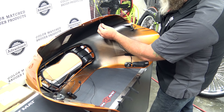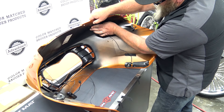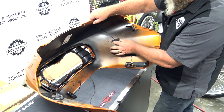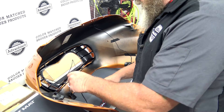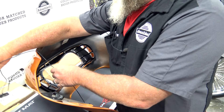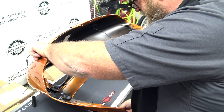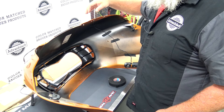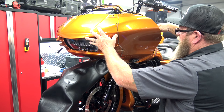When you're taping your wire back up in here, you want your wire to come out over here in between your two windshield bolts — basically right in that spot right there. So we're going to take some Tessa tape and go ahead and put that in. You can use whatever tape you want — it doesn't have to be cloth Tessa tape, you can use electric tape, whatever you want. We're going to make sure this comes out over here between the windshield bolts. Pull our slack in, add a piece of tape. That way, when you slide the outer fairing back on, your wires are right up top. I'm going to walk our outer fairing back over and slide it on.